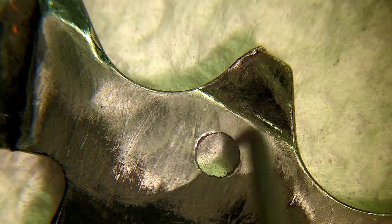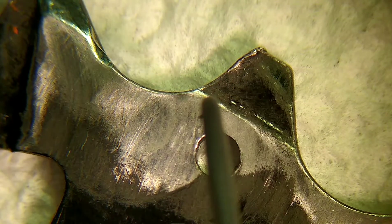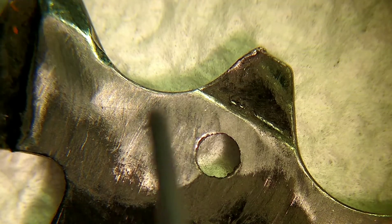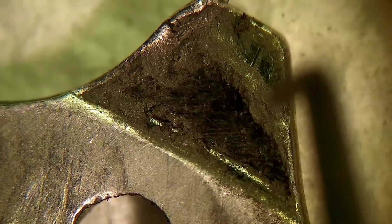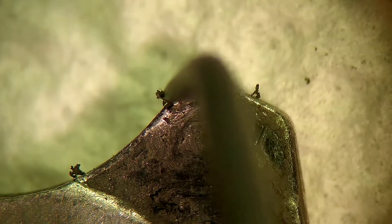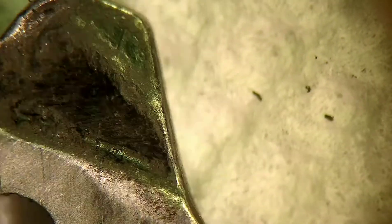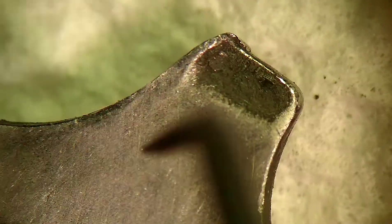I want to zoom in — I have it right now on a stereo microscope, which is another hobby of mine. I'll leave a link below if you want to see those videos. If you zoom in onto one of the teeth, I'm zooming in quite a lot. You can see where the actual part where the chain puts tension as you pedal forward is worn out — and it's not just worn out, it's actually been pushed forward like a pancake, as you can see on each of the teeth on the 18.